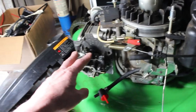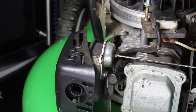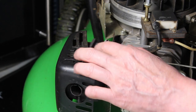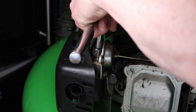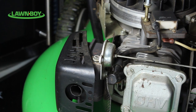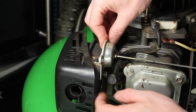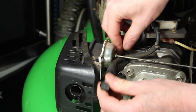We should just be able to slide this out and see what we're dealing with on the bottom, and see if we can make a gasket for it. I'm just going to take the nut off of here. This mechanism here mounts to the muffler — I explained on my other video this heats up and eventually turns and opens up this choke. We're going to remove this. This is the lawn boy 20-inch deck. There's another one down here that's going to be a little difficult to get to — I'll have to remove the spark plug.